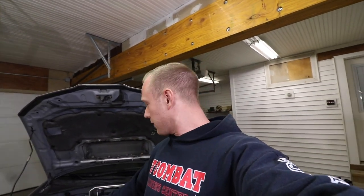One of the reasons you may have clicked on this video is because you're nervous. You're nervous if you get the engine wet, you're going to screw something up and your car is never going to run again. Well, I'm here to tell you, it's okay. I've done this hundreds of times. As long as you do the prep work and cover up all the vital components, all the electronics and the air filter and everything, you'll be fine. I'll show you quick.